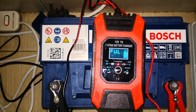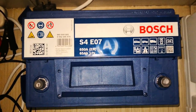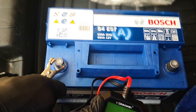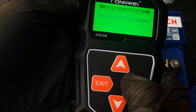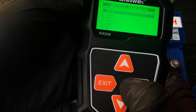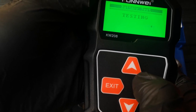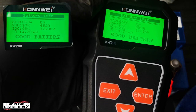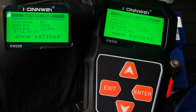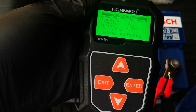The battery is now full — I had to switch to regular charging at some point, but yeah, battery is full. Heading back to repeat the test. We're now at 12.96 volts. Setting it to out-of-vehicle, enhanced flooded battery, EN, 650. As you can see, the state of health has improved to 97%, which is good. State of charge has improved up to 98%, and it's saying it's a good battery. At this stage, I'm comfortable to put this into the car.